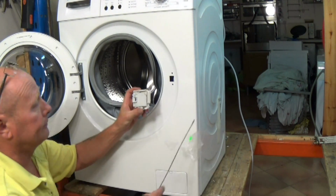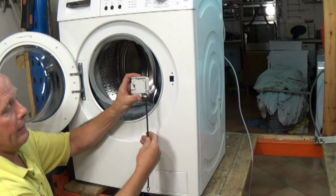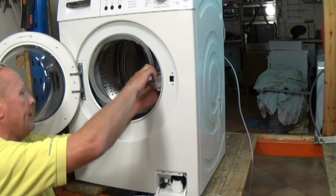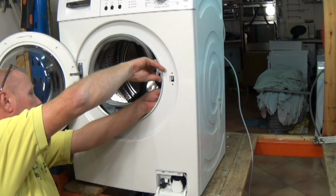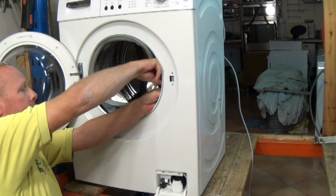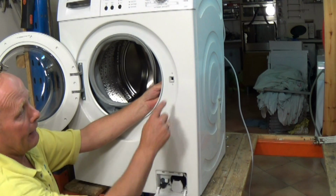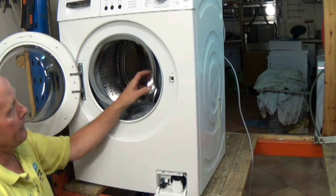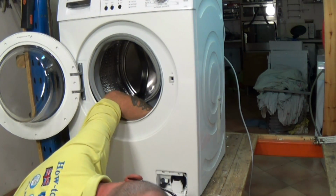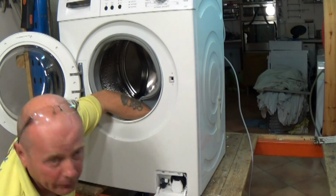The new door lock is there. Again, make sure you use the right end. Fits on like that. That slides down, and we will put that on in a minute through the hole. And all we have to do now is connect the wiring, and it's a plug connector, so it can only go on one way. Then the door lock goes into the hole, and then you slide it back, and the two pins lock it into place. And all you need to do is make sure the bar goes through at the bottom correctly. And the bar now is in place.